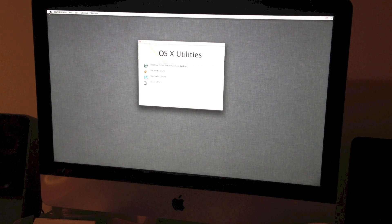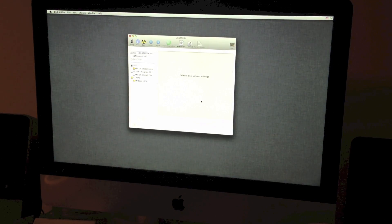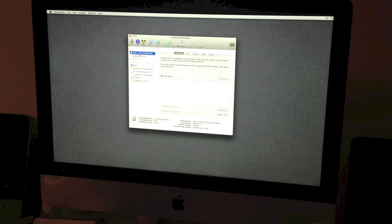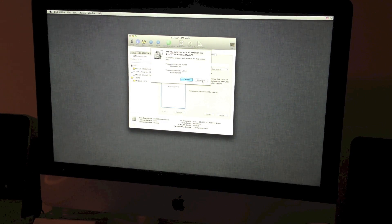Off the memory stick — that only took about a minute or so. What we are going to do first is go into Disk Utility, delete the existing partition, change it to one partition, and change the name of the drive to Macintosh HD as it is always called, then apply and confirm yes.